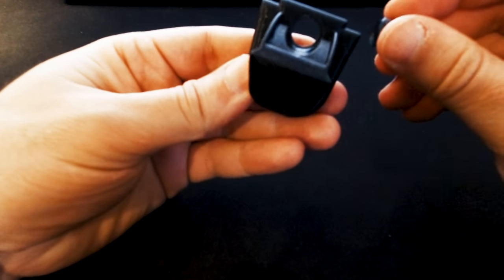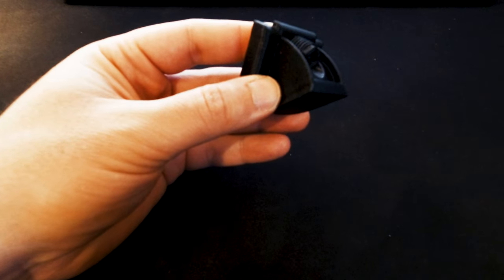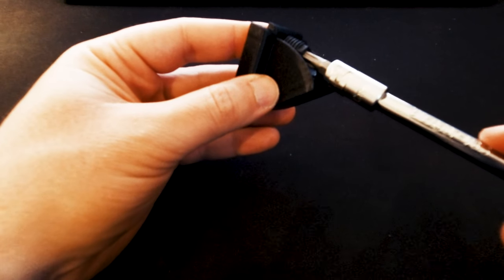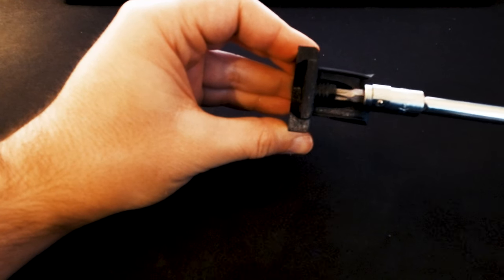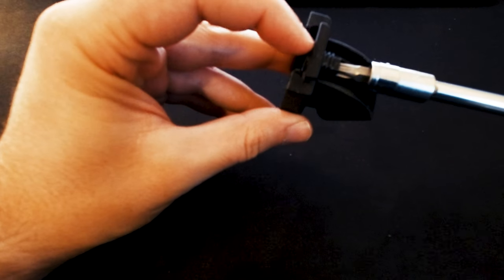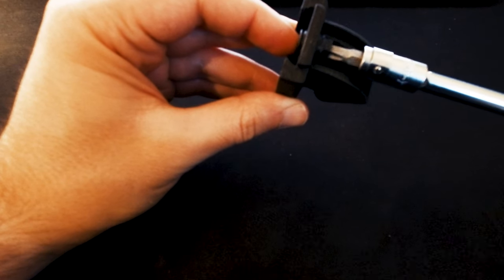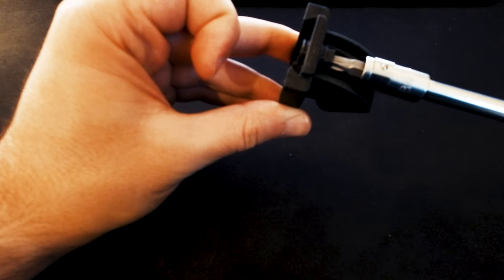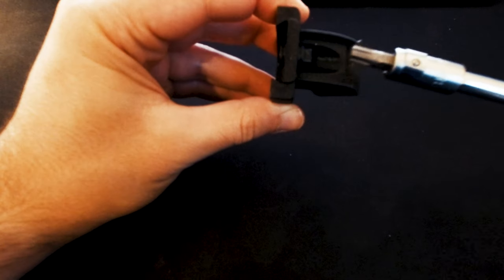This screw goes here — there's a cavity, as you can see. You can use the Torx T35 to screw it in. It will go further and further in; there should not be much resistance. Then you'll see it starts popping out, and this is what creates the pressure. The more you screw it, the more pressure you have. Just be careful not to break anything in your car.